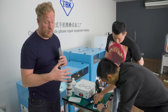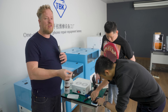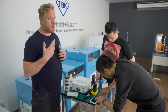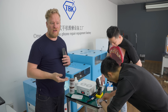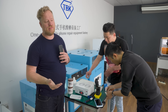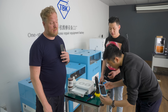This is for phone refurbishing, particularly at a wholesale level. The difference between a B-grade phone and an A-grade phone is often just scratches on the screen, but it's really labor intensive to take the whole phone apart, remove the screen, cut the glass off, put new glass back on, and reassemble — just to get rid of some scratches. They've developed a technique and a machine to do this in a way that is way less labor intensive.